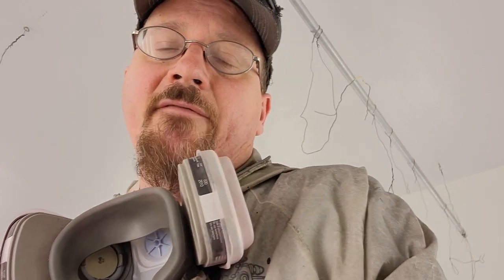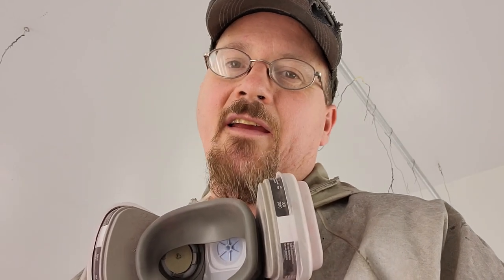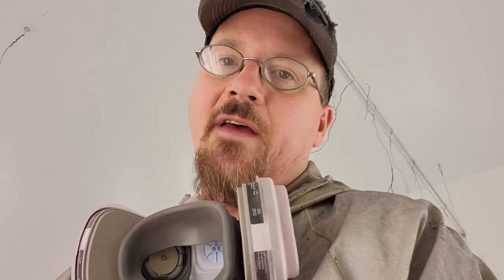All right, guys, while I'm getting ready, I'm gonna tell you how we're gonna go about this. This hot rod black's like a satin black color, and if you really drill it on there, I've noticed, if you try to make it flow out real good and slick, it'll shine just a little bit more. So we want more of a between satin and matte almost. So first coat, I'm gonna put a good tack, maybe a medium coat on, and probably second coat it. I'm not gonna dry spray it, you don't want to do that because you see lines, but I just barely want to wet it out.